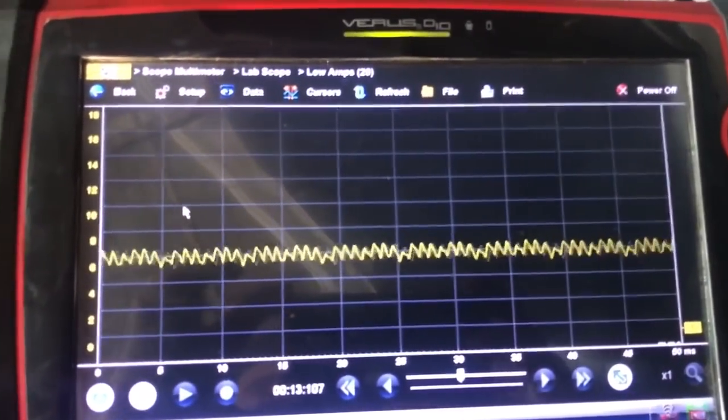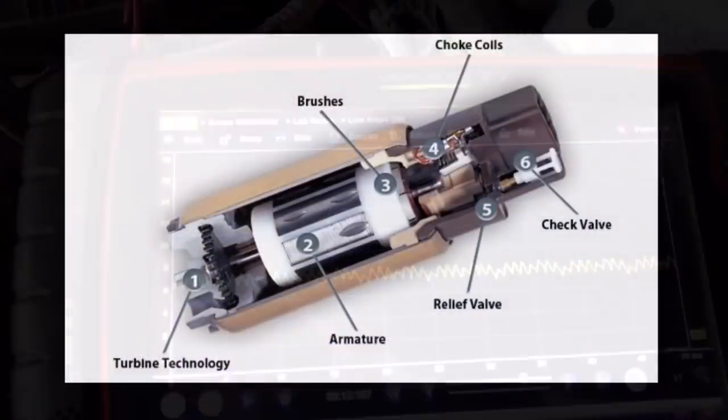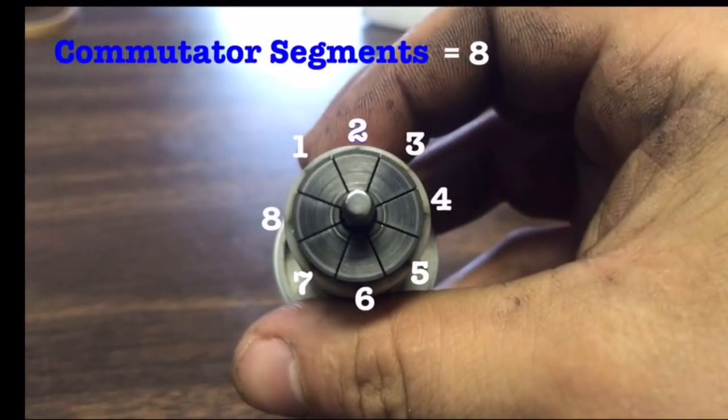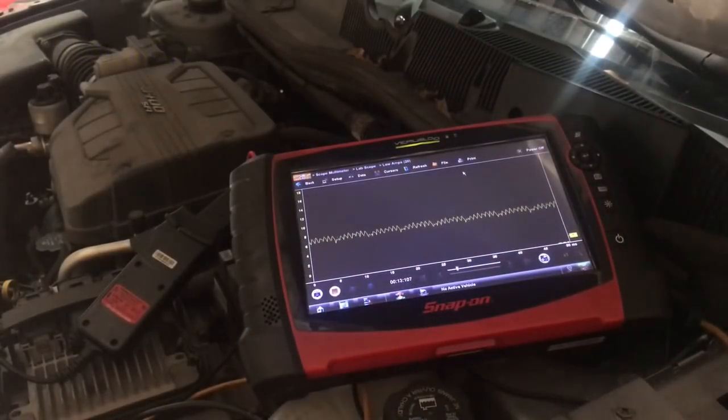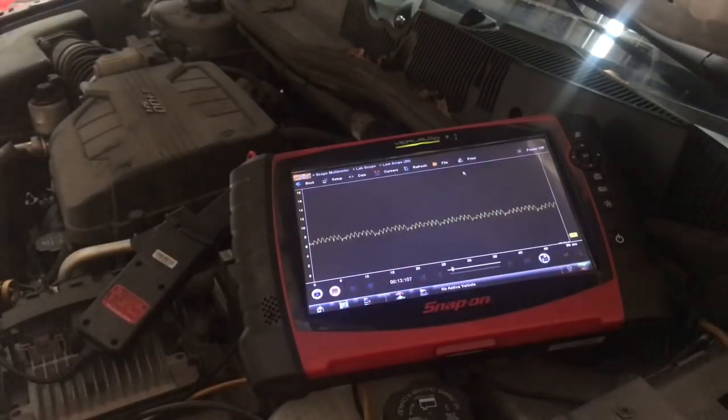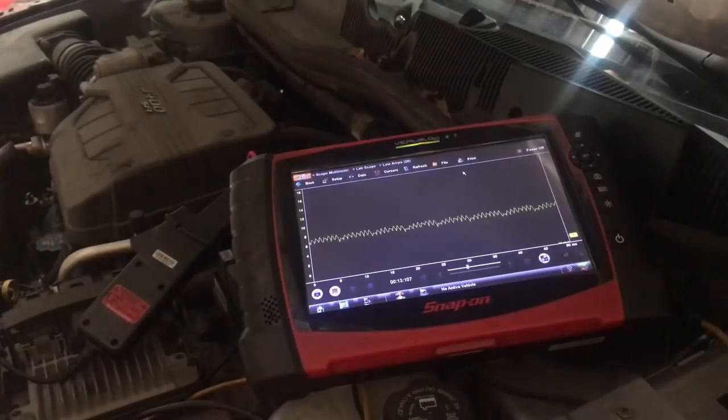This is the current ramp from our fuel pump. I'm going to post some pictures of the fuel pump and the commutators. So as you can see from those pictures, that's the inside of a fuel pump. Inside the fuel pump, you're going to have your armature — that's the whole assembly. And inside we're going to have what are called commutators. Commutators are the contact points where the brushes are going to be running through. These little bumps that we see right here — on a good fuel pump, we want to see uniform bumps. But sometimes you can find a distinctive bump, so you can know how many commutators we have.